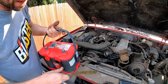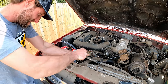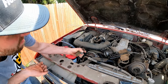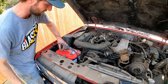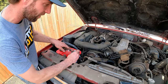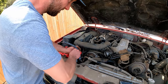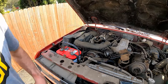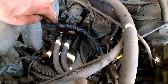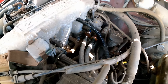Now I think it's time to electrify this party — drop in an Optima battery and put some power to the situation. Always a good idea to brush off the terminals a bit. I did the tap test and heard that clicking — then I noticed the key was on. I turned the key off — that clicking is gone. I don't want the fuel pump kicking on. Next, I'll take the fuel feed line off. You can tell which one's the feed because the return will have the pressure regulator attached to it.